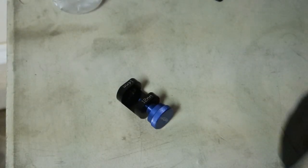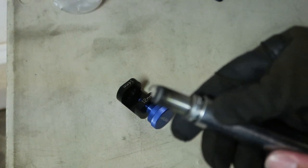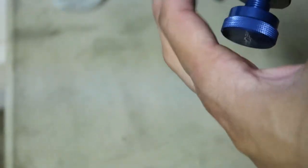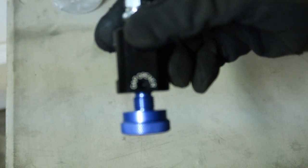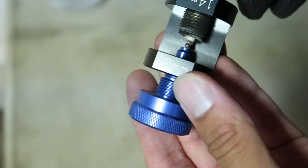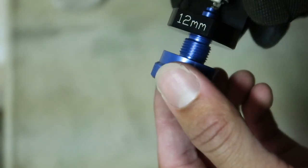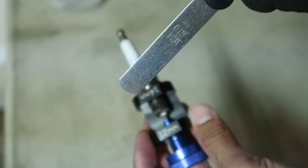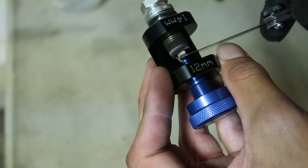I grabbed the glove because these spark plugs are hot. We got our real nice NGK here. We're going to screw out the other side a little bit — this is a 14mm — and get this on in there. It's almost touching. You can see on the back the gap opener. Now you can see that this is up against that. You want to have it facing up towards you and you'll be able to just turn this to make your gap. Apply the slightest bit of pressure, take the gap tool — I can't really see it on camera — but there you go, 0.024, and I'll slide it on in there. Boom. It slides in perfectly.